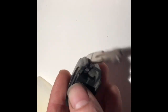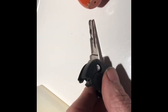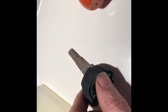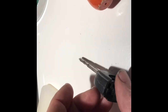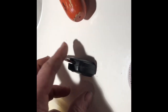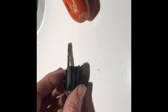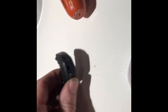You can see my problem is that the spring is done. So this has been a long process of trial and error. I got some info on Matthew's Volvo site, which basically suggested what you need to do is cut a thin line on the opposite side of the key portion of the fob, right through to the tip.